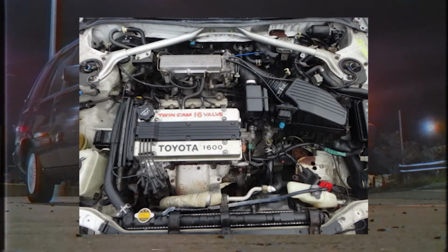The 3AC and 4AGE share the same stroke length, so I could swap the 3AC crankshaft into a 4AGE to keep the transmission compatible. The only issue with that is there may be some differences in the strength of the crank, which may limit how far the engine could rev. There is actually a junkyard near me that has a couple 4AGEs, but they have been sitting out in the elements for some time, so they would require a lot of time and energy.